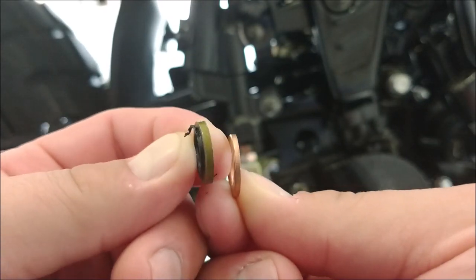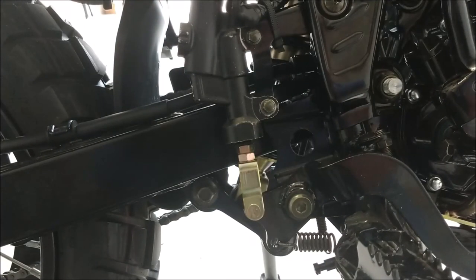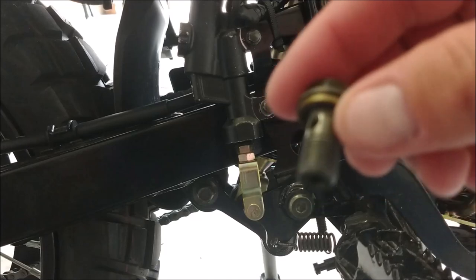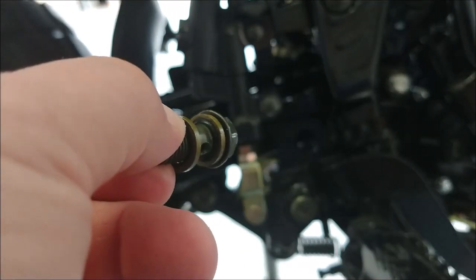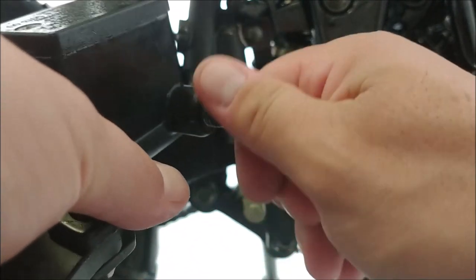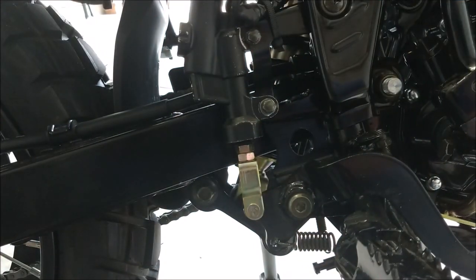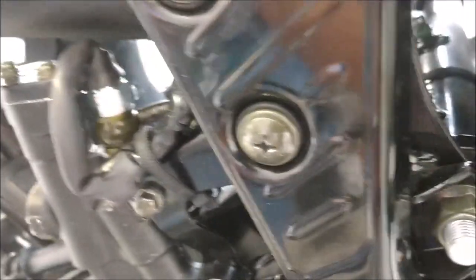This one's thicker. So when I put that Banjo bolt in, it wouldn't tighten those thin ones, so it would leak. This one goes in like that, and you have another one with the plastic in there. I thought I'd show you guys in case you're going to do the Banjo switch. I took the ones that came off of my hand control and put them in there. I bought those crusher washers at, I think, Advance Auto. They didn't work for me. But it's done now. Like I said, I made it work. So, thanks for watching.